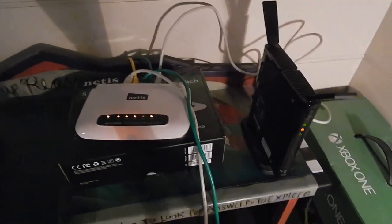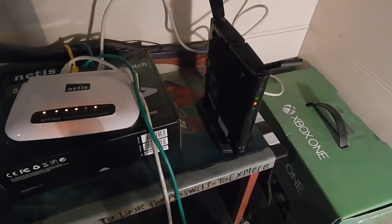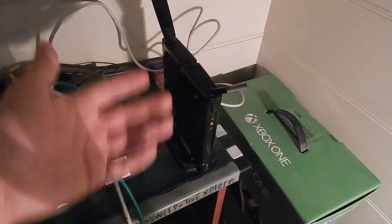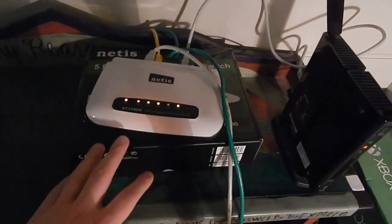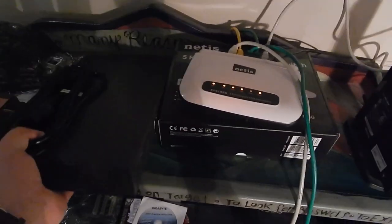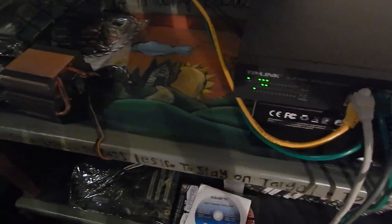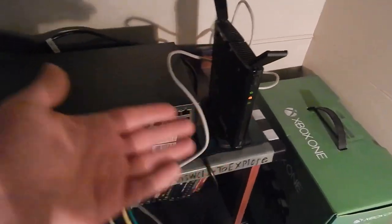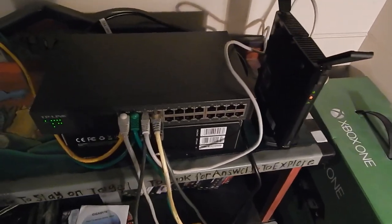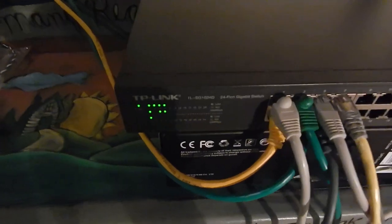So I've decided to just go wired where I can, and use this router for wireless connections bridged to the switch. I've put this router on the network through the switch rather than through another wireless connection. The only thing going into the router is the link from the switch — that's in port number five — and that connects to one of the ports on the back of the router. So that puts this router on the network so it can send wireless signals out to phones, tablets, laptops, the bedside computer, all that good stuff.